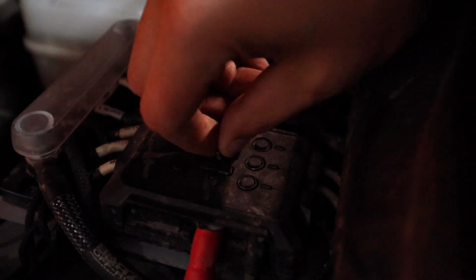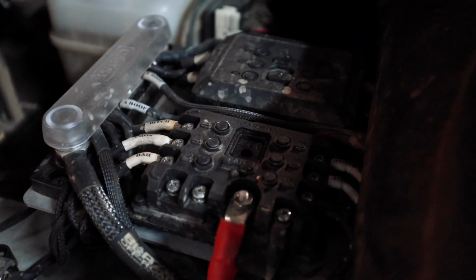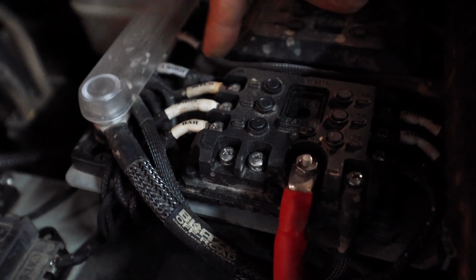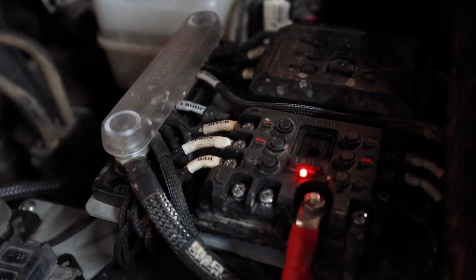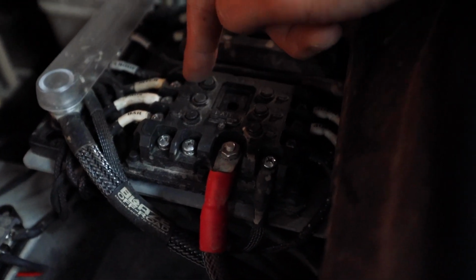Wiring is really easy. You just take this little guy here, twist it, and now, if I can get it off, you have access to what you need to wire. So anything that is power, your power source is here, everything is grounded to the ground bar here. Basically, you take the power of each one of the accessories you're going to run, straight to the Garmin. Now this one, boom, is run straight there to the ditch lights.